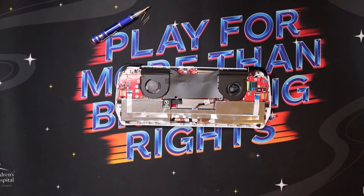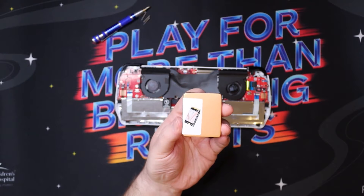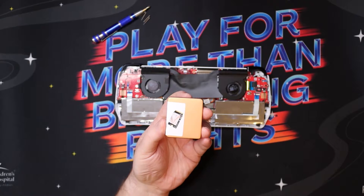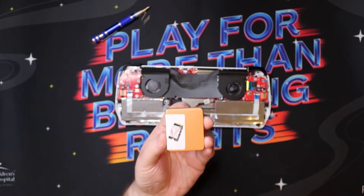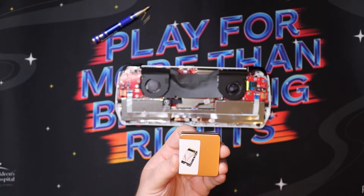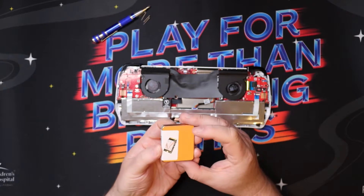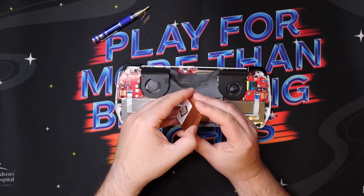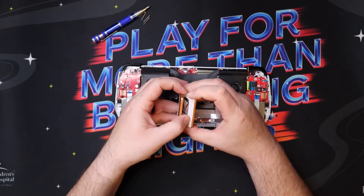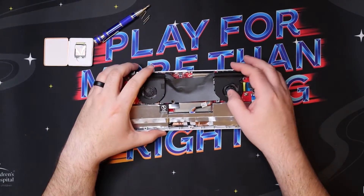Now what we're looking for is the storage, which is going to be under this black paper here. What I picked up is the Sabrent two terabyte drive off Amazon — that's a 2230 drive. It's not your typical M.2 drive you'd put in a computer or laptop. The problem is they're kind of expensive, but at the time this was the best rated for the best price. Western Digital came out with one recently too. I'll put a link in the description below. You can see how tiny that drive is — not your typical size.